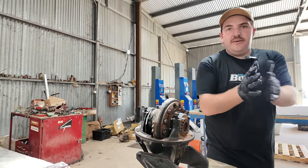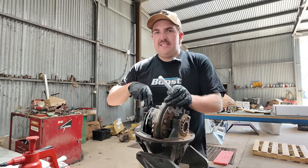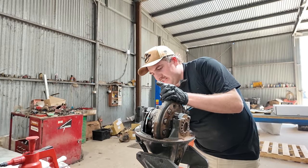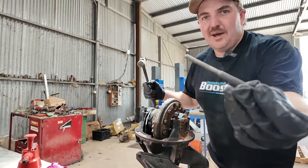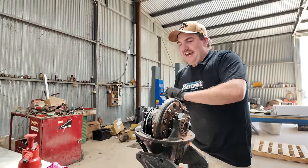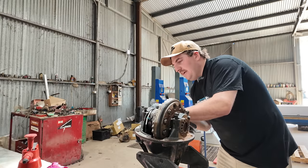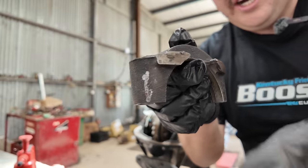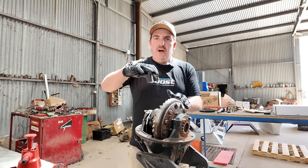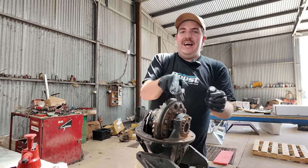This is an important part. I'm just going to grab a paint pen and put a mark on this cap here, just so I know which side it's from. And this here is a center punch - I'm going to put two little dots on both faces. That way, if I accidentally wash the mark off, I'll still be able to know. When I put it back together, I won't try and put that on the wrong side.